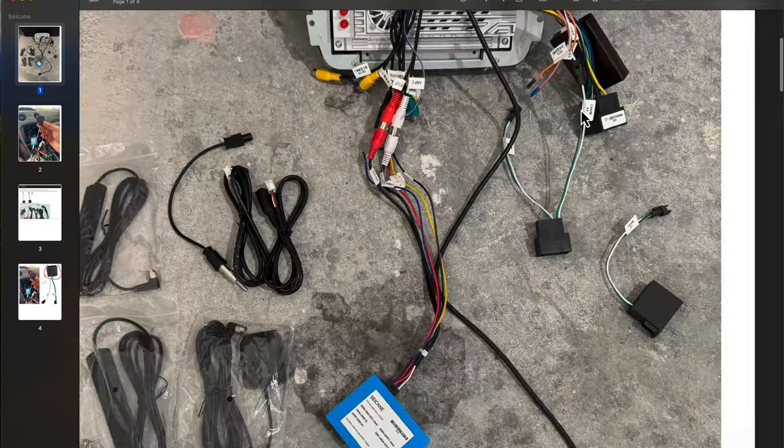I've plugged these in. To save yourself trouble before disassembly, do some prep work now — it'll make it a lot easier. Take the T-Tap connectors; I use the blue ones — they fit best. Take three of these and put them on the red wire, the B for battery wire, and the ground wire. If we do this now it will save a lot of time later. So go ahead and do that — you'll need a crimper.